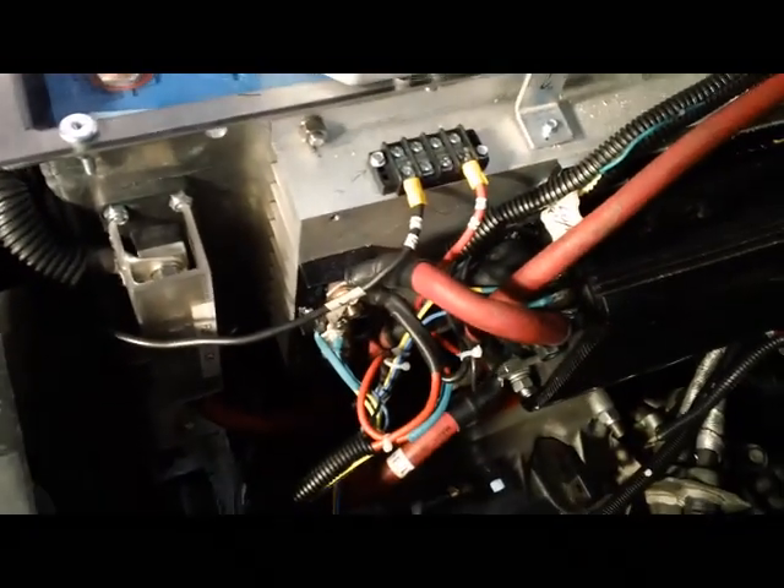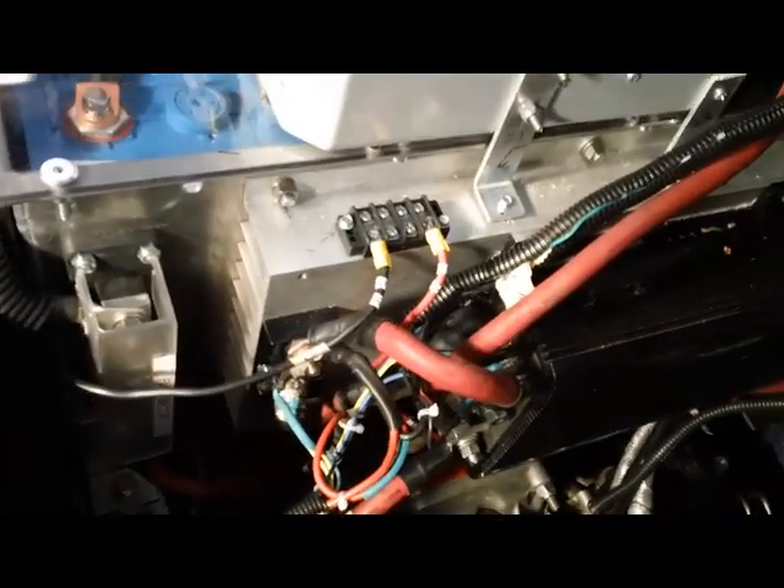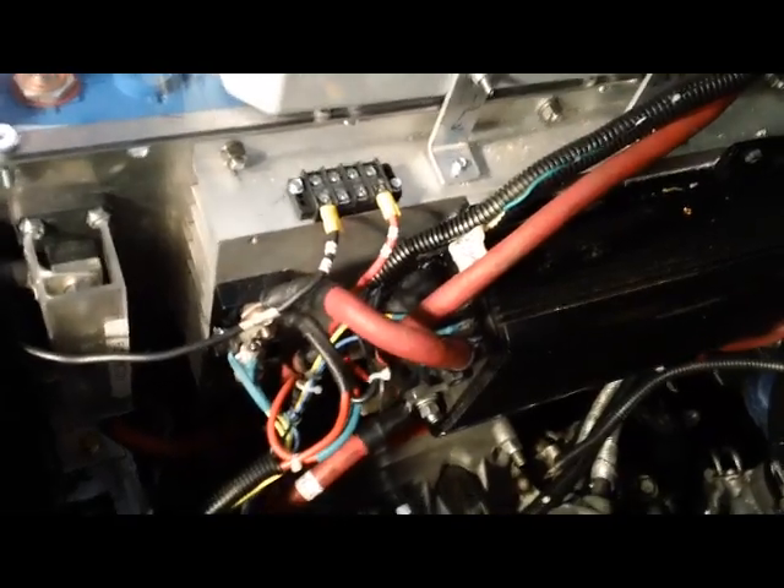Attached on the side, the two wires on the top are the most negative and most positive from the battery box, so I can take an instant reading with my meter to see the battery voltage — I'll put a cover over that so it's not exposed. There's a fuse block with a fuse in case of a short. To the right of that is a shunt, which allows me to get all my measurements to the amp meter and my e-pro.